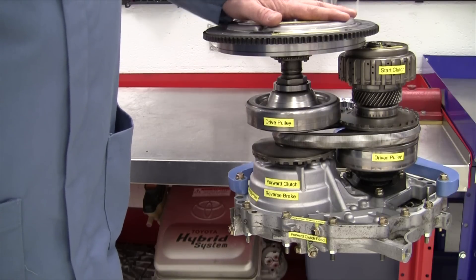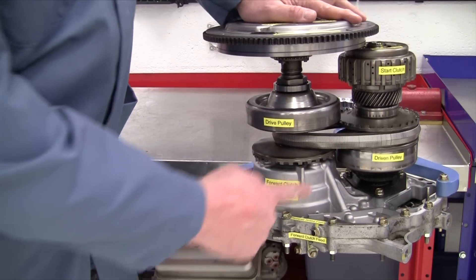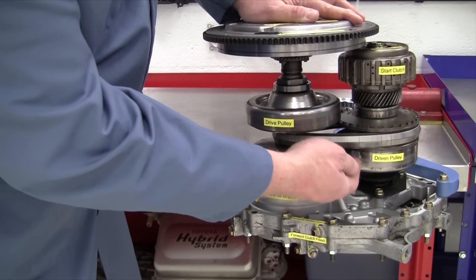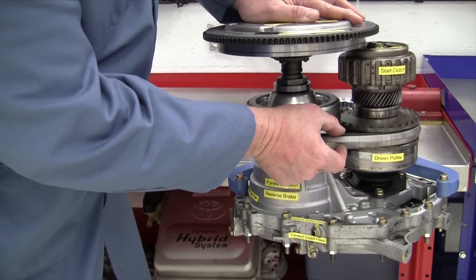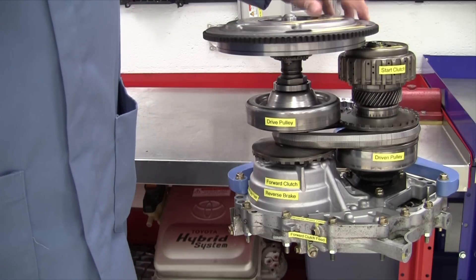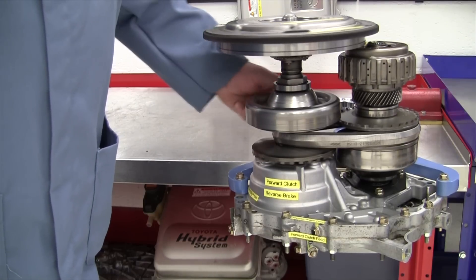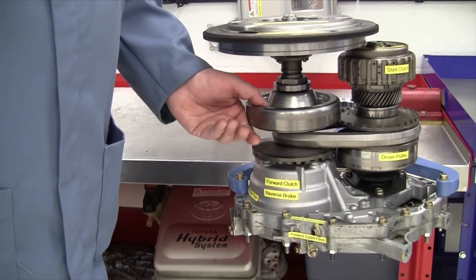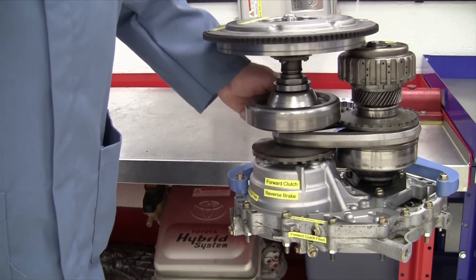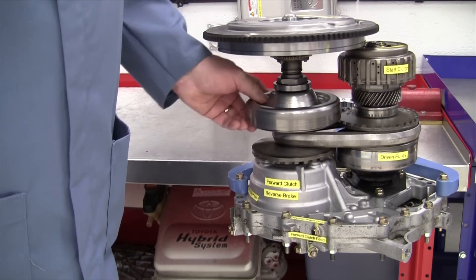This particular CVT is actually a recalled transmission for a belt failure. We've got all these little keys here, and then a bunch of little steel belts on the top and bottom of the keys sandwiched together that hold those keyways in place. As I turn the driven pulley, you hear a snapping sound — that's one of the steel belts that has failed in the drive belt itself.